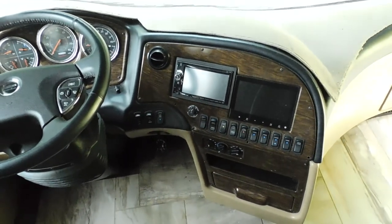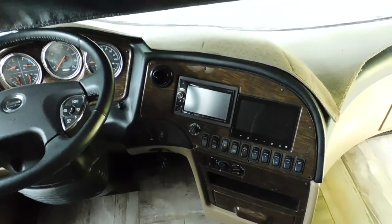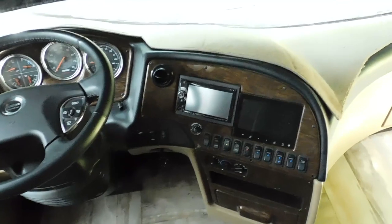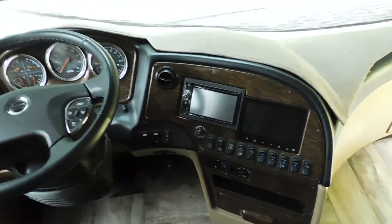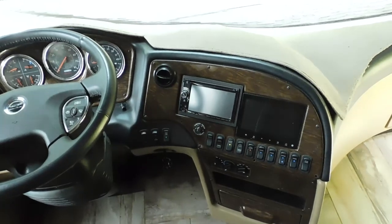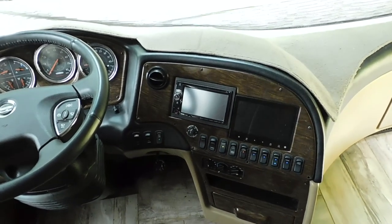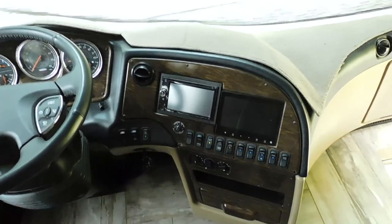This is with the main shade going down and the battery is reading 12.9 volts right now. Started out at 13.3 and a couple of lowerings and raisings of the shade have dropped it down to 12.9, which is pretty quick. Shore power is not hooked up though, and we'll try this one over here.